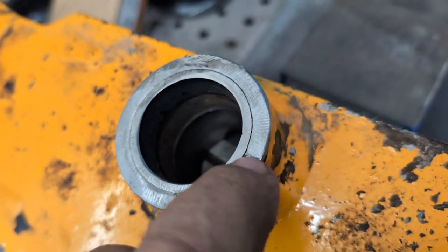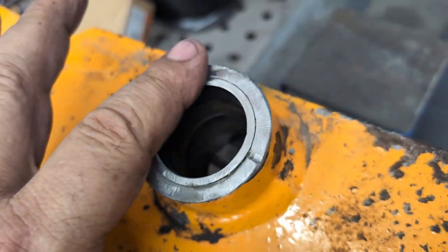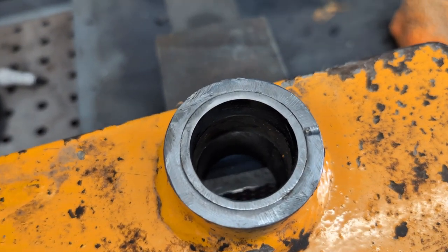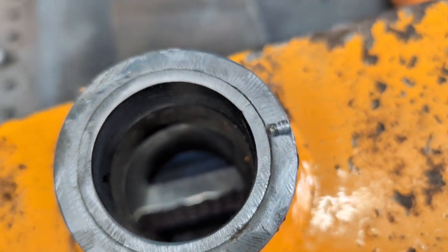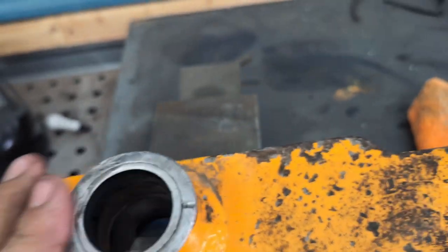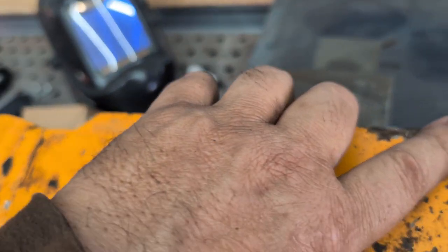You can see a little cut right there — that's where the old grease fitting was. They machined it, but the machinist wasn't there, so the shop assistant took it on his own to machine this. Does this look like a nice machine surface? Look — see how it lips up here? Of course it doesn't fit in there. That end was supposed to be cut and then machined true and flat — and it's not.